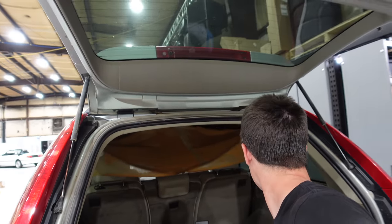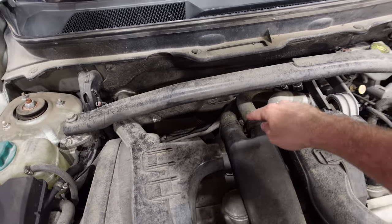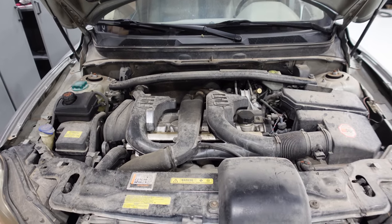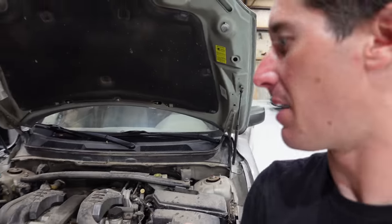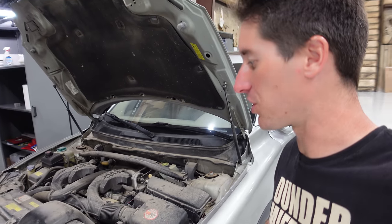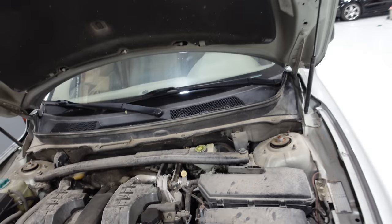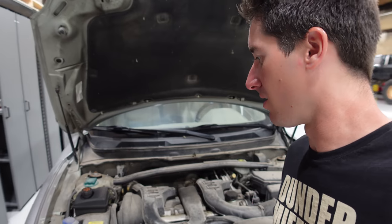It's a premium audio, which is the step up, and a five-passenger. I don't think it has the back seats. Let's take a gander at this power plant. This is the T6 — you can see there's two different inputs into this thing because it is twin-turboed. 268 horsepower, 280 foot-pounds of torque — considerably more than most of the T5s. It's got the MAF unplugged for some reason, which is kind of interesting. In general it just looks like it's been rough for quite a while.